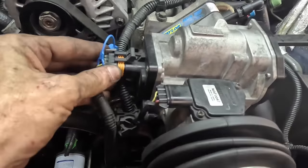We reveal all the drippages. Look at that. That's nasty. Okay, I think we're good there. Set her down on the locks for some safety. Lock clickage, good. So now, I need to get this old lower radiator hose dug out of here. We'll plug the new one in. This is the new lower, not the new upper. Guess I can close up the radiator now. The drain is done draining. I ran out of flange strength.